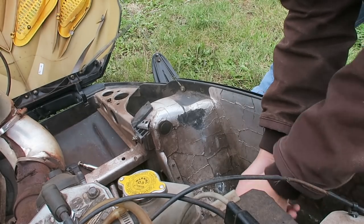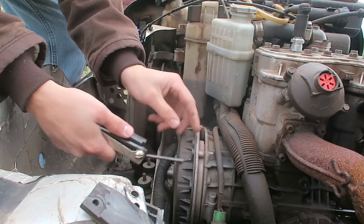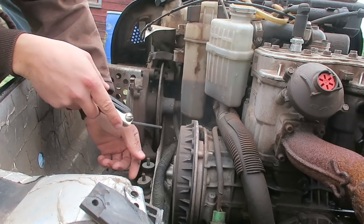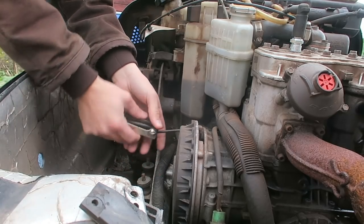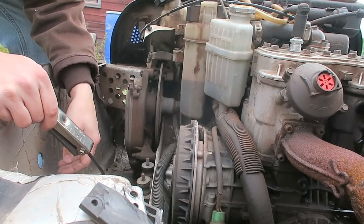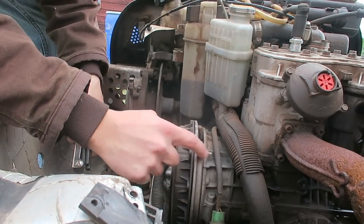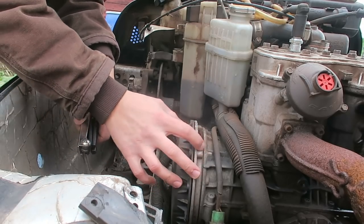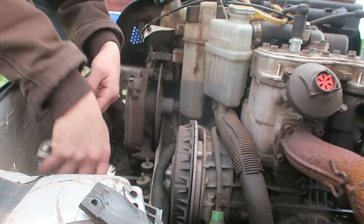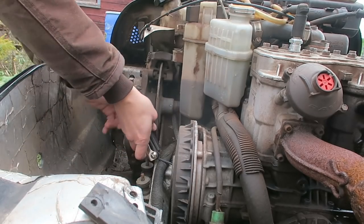That's the one! I can see some of my loctite in there. That's why it broke — one of my bolts fell out. You guys probably remember I replaced this whole flange, this metal piece where the bolts actually go, because the other one was stripped out. I replaced this piece but apparently the bolts are still vibrating out, which is not cool even though I put blue loctite on there. What a pain — one thing after another.